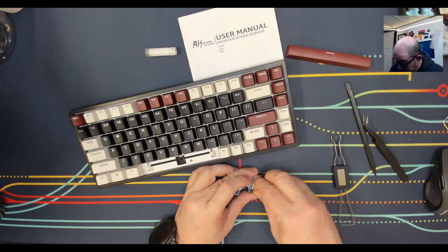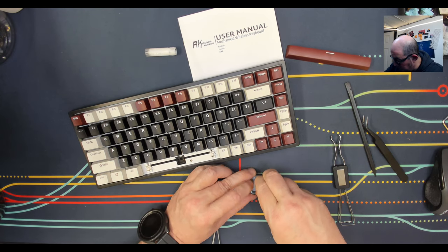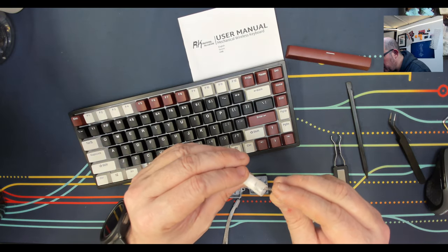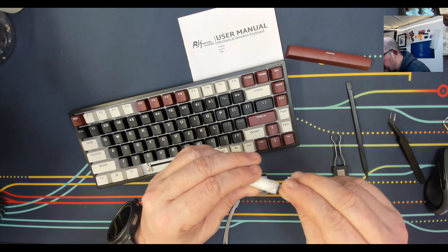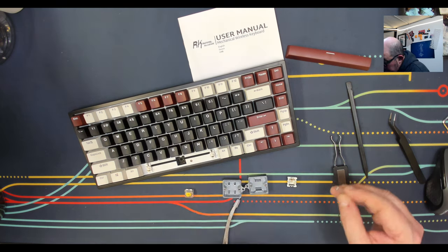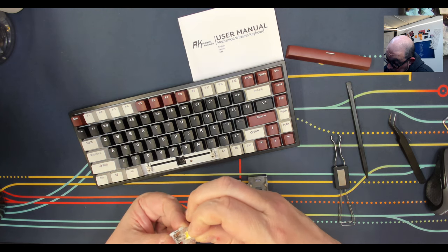Well, I thought they were Gaterons till I opened them. They're RKs. I noticed that they had wing latch, so I was like, wait a minute, that's not a Gateron. I'm not really lubing it. I'm just going to not donut dip, but donut roll the outside, the bottom. That way I keep from getting any of the grease. Oh, got a little too much there. This is to stop the resonance. Stop that ping, at least right here in the space bar.